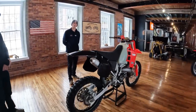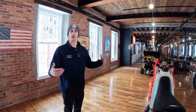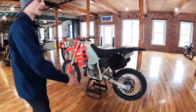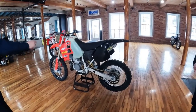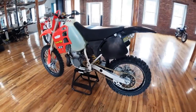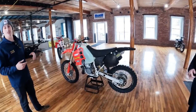Andrew, I got the same clutch on my bike and it's like night and day, especially in thick sand with a paddle tire. I actually first tested this bike in a sand wash with the 15/44 gearing combo. It's currently got stock 14/49 on it for track riding. With a 15/49 or 15/44 you actually have to shave the case a little bit to make it fit, which I know some guys are cringing hearing. What it really needs is updated suspension — the suspension on this, I don't care what anybody says, is god awful. The front forks are just far too small — 46 or 47mm KYBs.